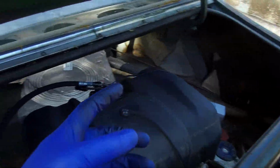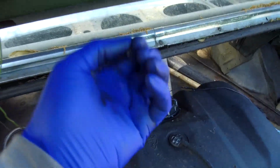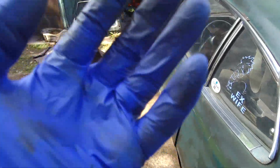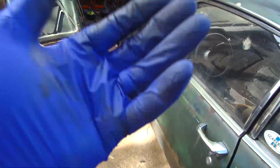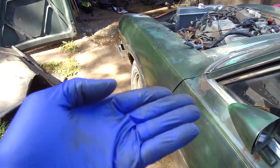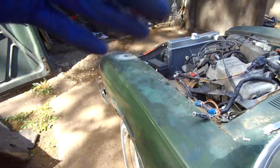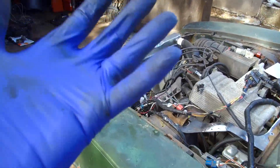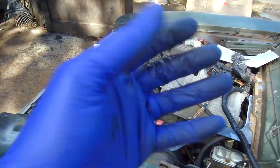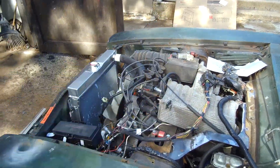Now with the Maverick fuel system, the fuel pump, right, the hose wasn't legit. It soaks up in the gas and it gets real soft and it pulls itself out. That's what happens. What I should have done is, when I start the car, turn it off at the fuel pump first, drain all the gas out of it, then turn off the car. Then it has no pressure in the lines and it will last a little bit longer. Or don't put that much gas in the car until we get a fuel cell for it.